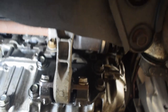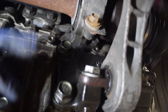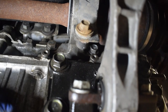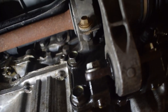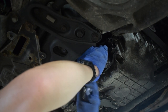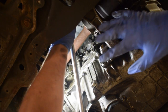Now as you come across here this driveshaft is a lot longer, so you've got a driveshaft support bearing. That's got a bolt for a heat shield, then you've got a couple of bolts above and then one or two underneath as well. Under there is going to be hard to get to, but then obviously that driveshaft goes into the gearbox — that's where we're going to take it out from. Let's try and get to these bolts. I've got a 10mm ratchet spanner — that's one bolt there, one next to it, and one more above. We've taken the heat shield off.